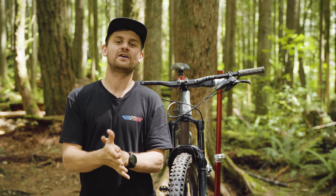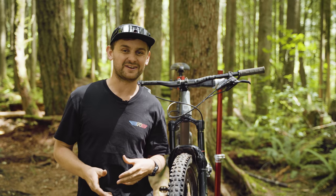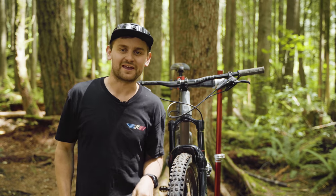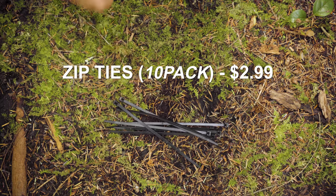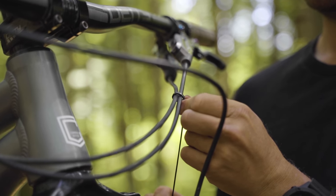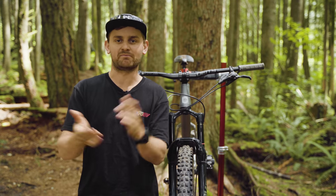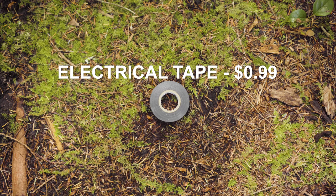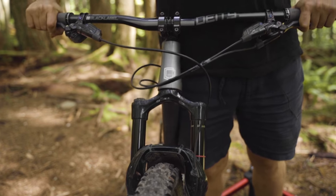Another source of cable noise is up in your cockpit. On the enduro bike I don't have any cables rubbing together, but on the hardtail I do, so let's use that to show a few options from the local store. First option is the classic zip tie — think about what's going to happen to the cables when the fork goes under compression and tie them on. Second option is electrical tape — not the strongest, so keep in mind that it can rip pretty easily as the fork compresses.